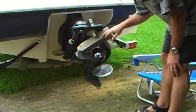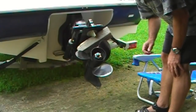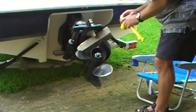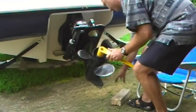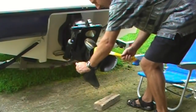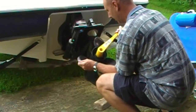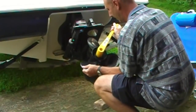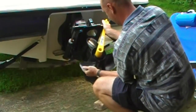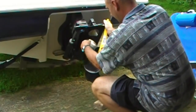I've activated the kill switch inside the boat, and now I'm going to get the prop wrench on here. For those of you who forget the old term: righty tighty, lefty loosey. Once you get the initial loosening done, you can hold the prop with your hand. Another method once it's loose enough is to turn the propeller while holding the wrench still — you can even brace it against the anti-cavitation plate for a little extra support.